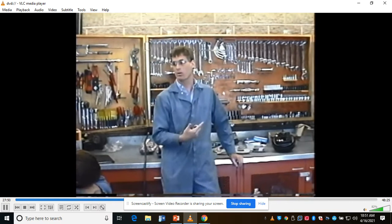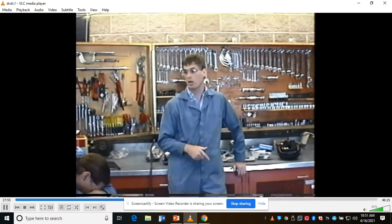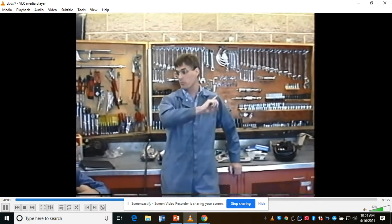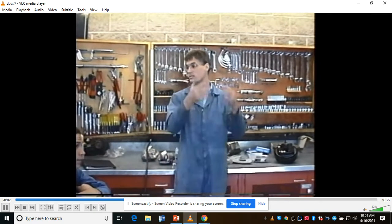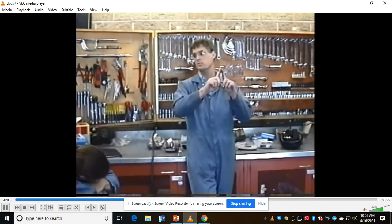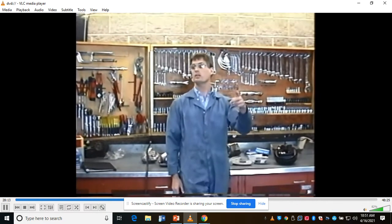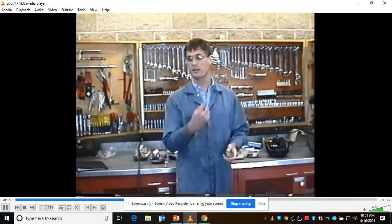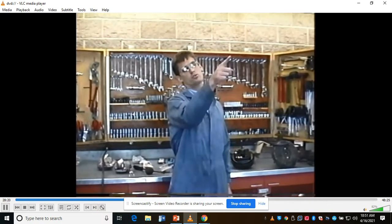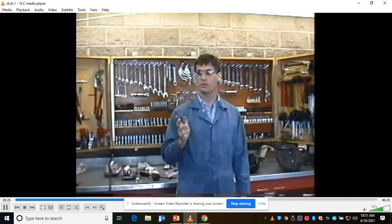Well, I found out by reading an article where I originally found this conversion in National Nostalgia Nova. But if you call the junkyards, they will tell you. They know what your ball joints are, or you can look in the new parts book, and you can see that the cars use, say, the same upper ball joint but different lower ball joint. And the stud size of the ball joint is actually larger on the Chevelle. So if you're going to use the Chevelle spindle on the Nova, you've got to change the ball joint. In order to do that, you have to machine the lower control arm, and you can do that. Or I can take this drum brake spindle and machine the spindle to accept the disc brake parts, and that's what I'm going to do.